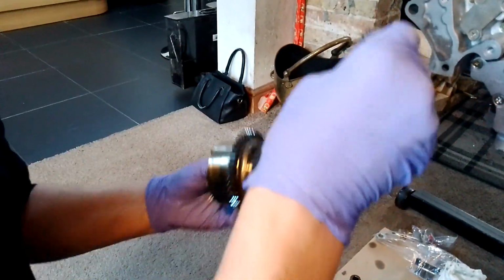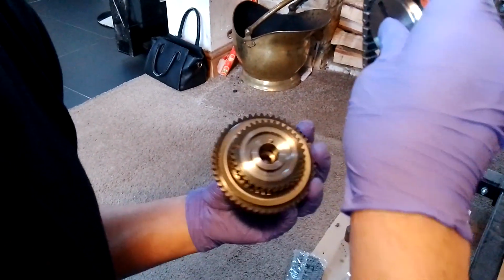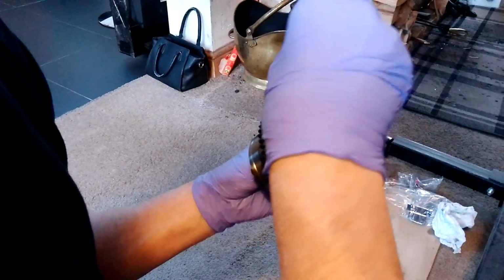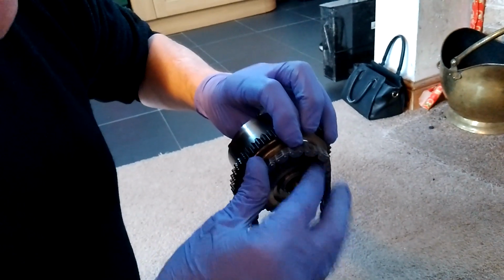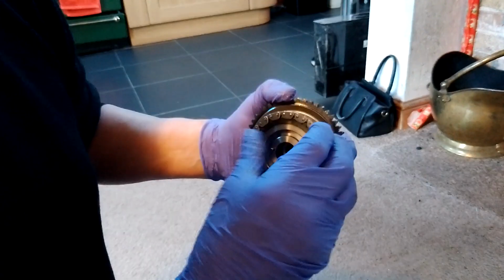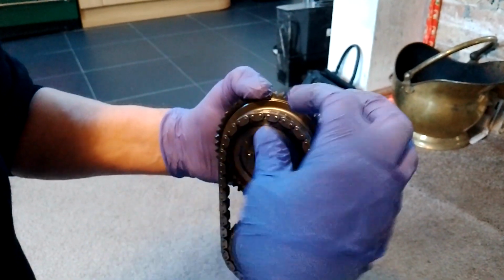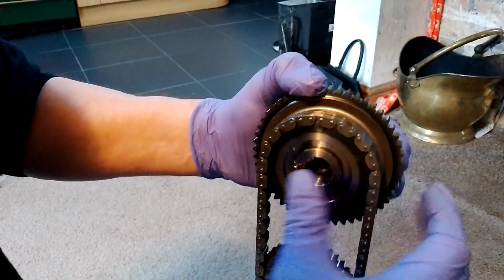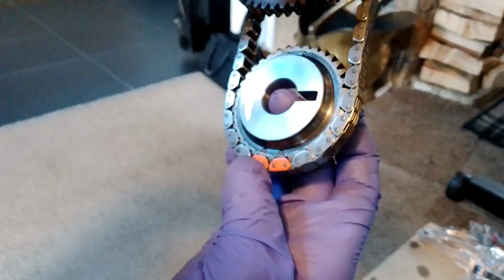That's the outside. So that wants to go. Oval timing mark, where have you gone? There it is. I think I've got it in the wrong place, but let's double check. Timing mark, coloured pin, got it one over, move it over one place. Coloured link, timing mark. So, you can see it again at the front, timing mark, coloured link, 2 timing marks, 2 coloured links using the ovals.